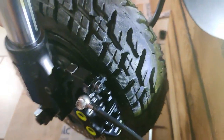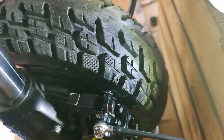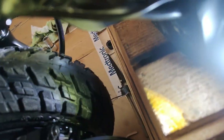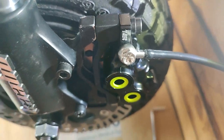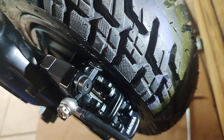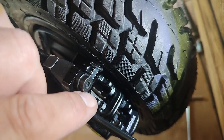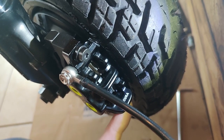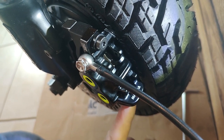The tire is nowhere near it. Scooter, we're dealing with a very fat tire, very close, squeezed together space, and very close to the brake caliper with these huge calipers. So the problem is that with many setups and tires, there's not enough clearance. The Banjo on the caliper is touching or rubbing on the tire.